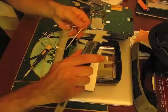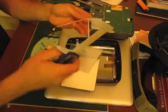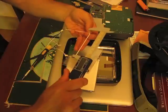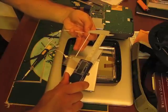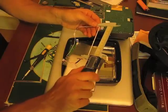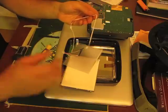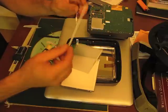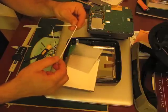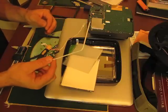Then you want this dimension: from the end of the glass to the far end of the bend. This one is 80 millimeters by 111 millimeters. What you then do is go to ccflwarehouse.com and find this lamp. It's a $15 lamp and you order a replacement.